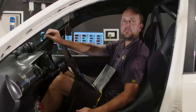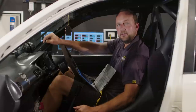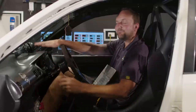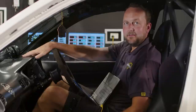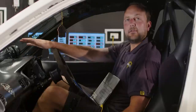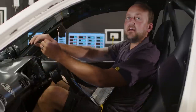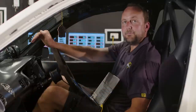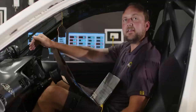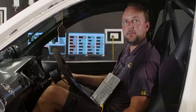Likewise, when you fit a set of awesome Yamaha R1 drive-by-wire individual throttle bodies on a beautiful custom adapter to put onto your K24A3, you're not going to make any more power. It's going to sound absolutely amazing. You may or may not get better throttle response, but something like this, it simply doesn't have the runner length. So that's the missing part of the puzzle. We now need to have a look at it and we need to start adjusting that runner length in order to make the most power we can at the desired engine RPM.